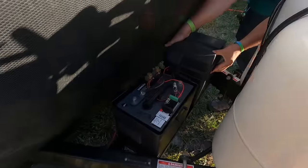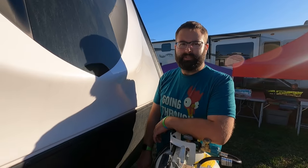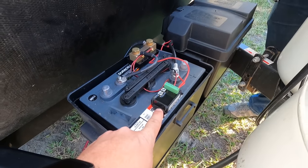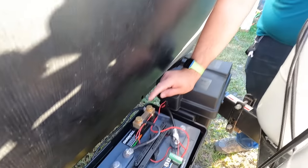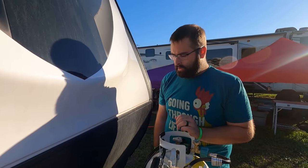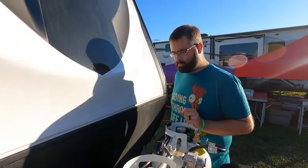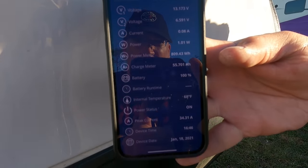Over here up on the nose, he went with two golf cart batteries — which we did the same thing on the 312, because the 12-volt RV slash marine batteries are garbage. So he's got two 6-volt batteries. He also attached what turns out to be a battery monitor, and that's the shunt for said battery monitor. He went overkill on the shunt because he knows he'll reuse it when he goes lithium — could go up to four or six batteries in the future. This is the Thornwave system — it has an app you can access from your phone.